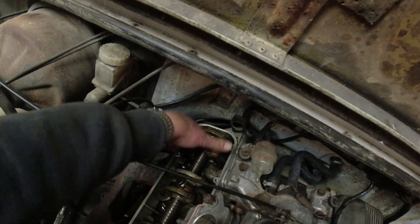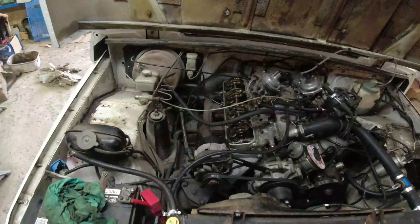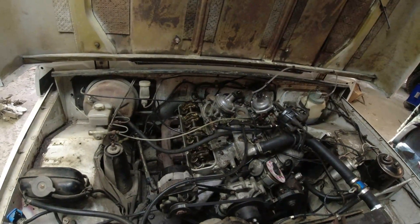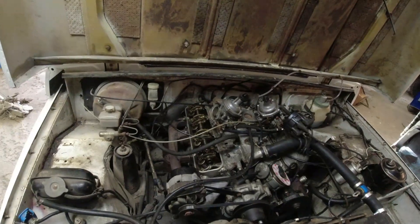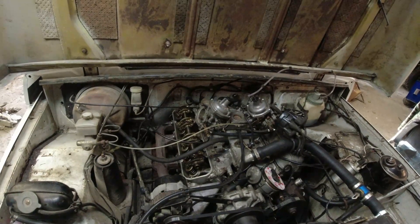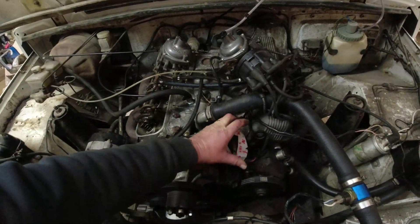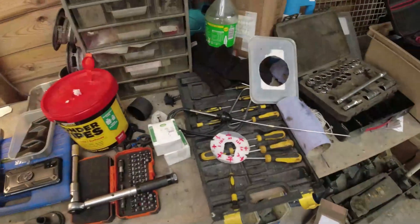On number eight I can feel very, very slight movement on that - none on that, tiniest bit of movement on that. So now I'm going to put the ignition back together and start this thing up, run it without the rocker cover and just see if I can identify the noise at all before I start digging into taking the inlet manifold out. I'll probably end up giving it a quick run up and down the motorway first. These templates are always useful - I love it back in my box of useful bits.